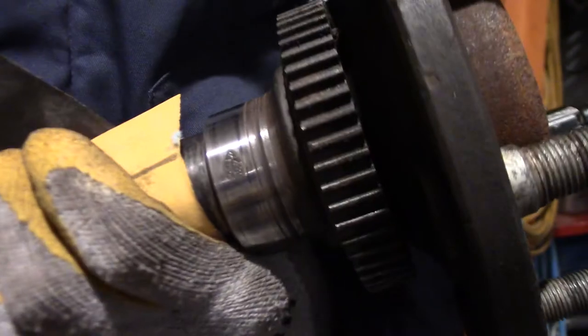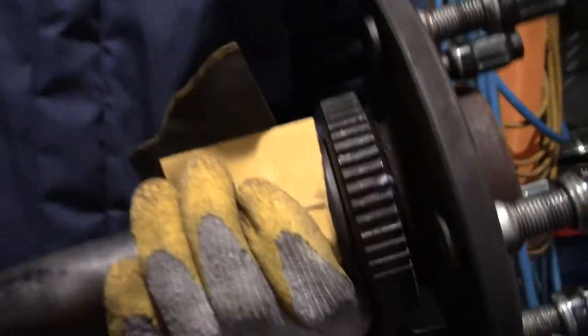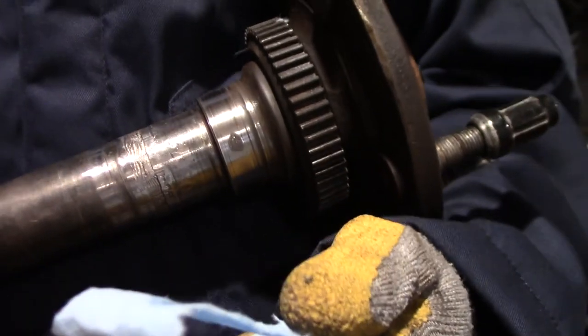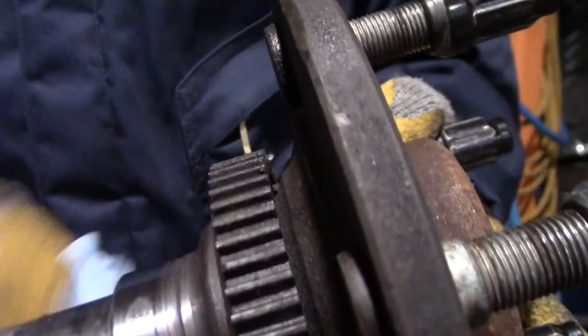It's looking a little better there. Keep doing this, but then definitely going to put the sleeve on it. All right, next I'm going to take some brake cleaner. Clean up the sealing surface, make sure there's no grit from sanding, no oil on it, and then I'm going to put some RTV black on the sealing surface and on the Speedi-Sleeve.